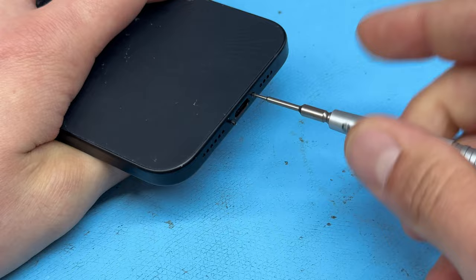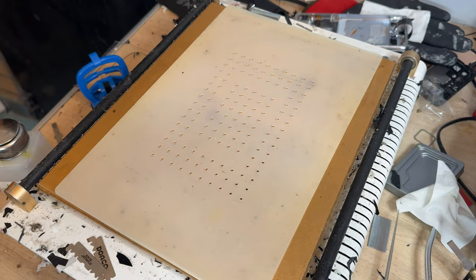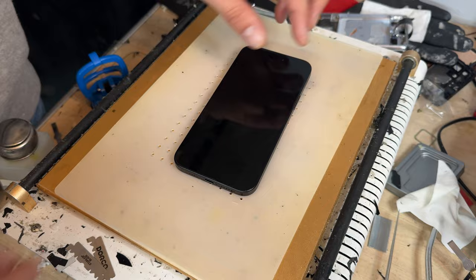These don't always come out with the screwdriver, so you might have to use your tweezers to help you with it, and then store them safely for later. We can now take this over to our heat mat where we're going to use the heat to soften the edges. I've got my heat mat set to 85 degrees C and I'm going to put it on there for the next 10-15 minutes to fully let that adhesive soften.